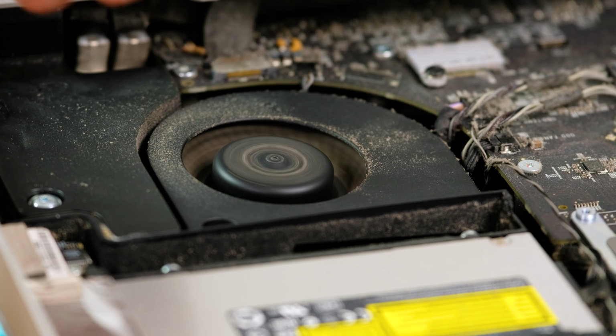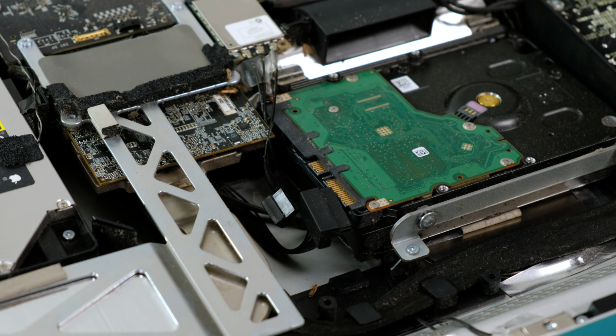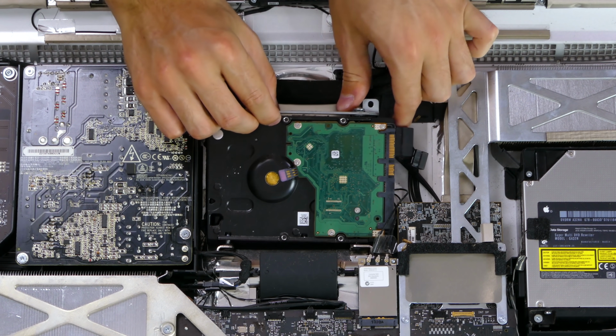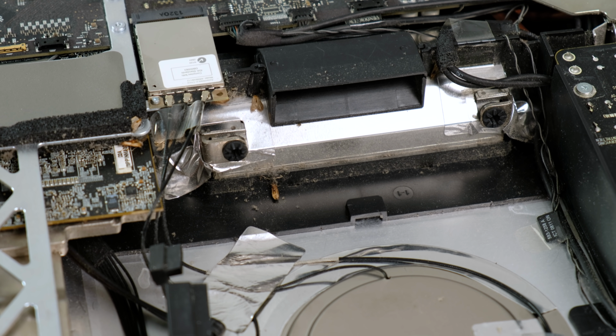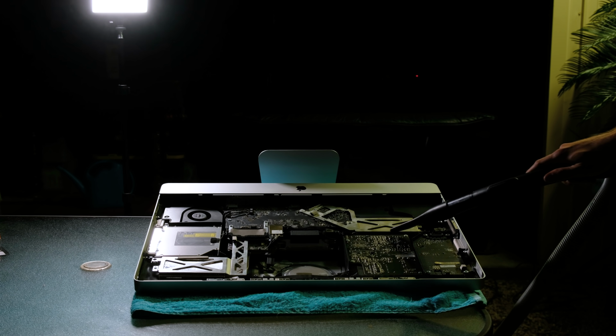One thing it's going to need is a good dusting. To remove the old mechanical hard disk, I unplugged the power and SATA cables, followed by the 2 Torx screws holding the drive in place. It looks as if bugs were also inhabiting this computer. To remove the bugs and many years worth of dust, I sprayed it with high pressure air.